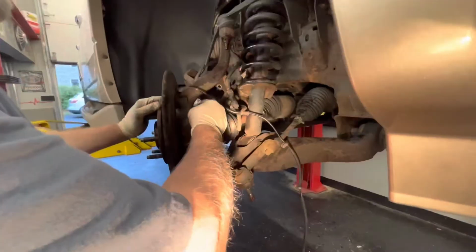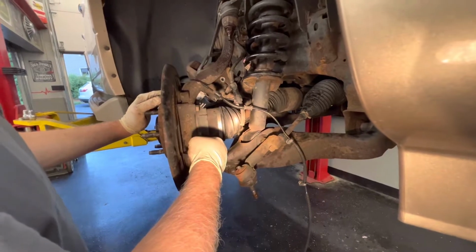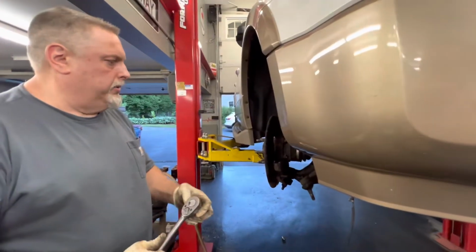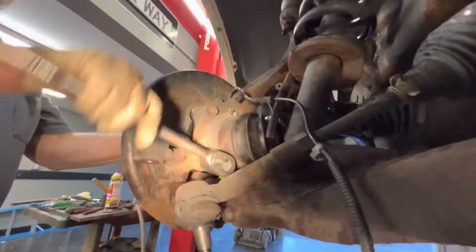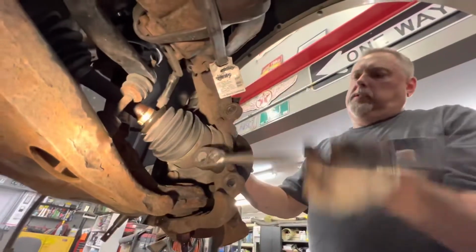Okay. These were 129 foot-pounds for these bolts, for the 4 of them to hold it on. Man, they didn't seem like they were that tight when we took them apart. Okay, so we got the 18 millimeter shallow socket. I'm going to crack these loose. I'll get the air ratchet after I crack these all loose.